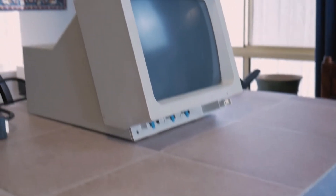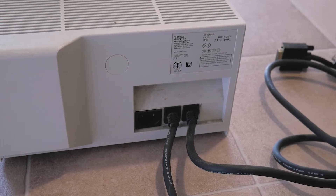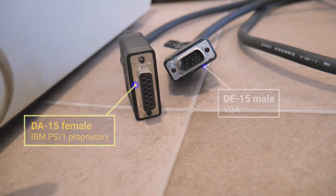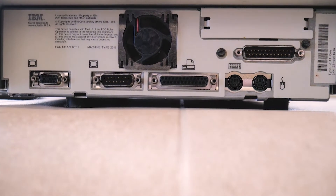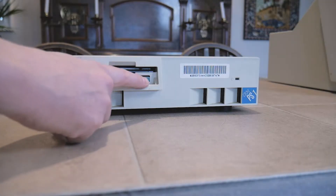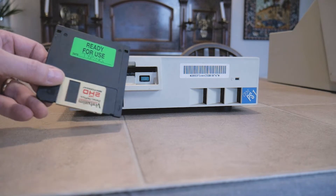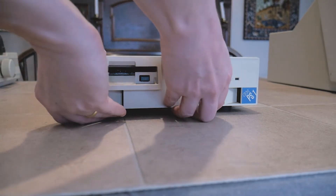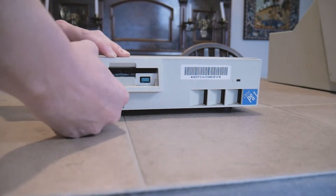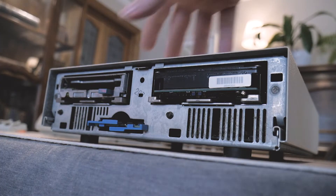The VGA monitor is unusual — it contains the PC speaker but also the computer's only power supply option, providing a standard VGA connector beside a proprietary DA15 cable that supplies 36 volts DC to a DC-to-DC converter inside the main system unit. The model 2011 comes with a 1.44 megabyte floppy drive popularized by the PS2 range and an optional hard drive of around 30 or 40 megabytes. Unlike later PS1 models, it has a 286 CPU and usually 1 megabyte of RAM, and either a modem as standard for USA models or an RS-232 interface otherwise.